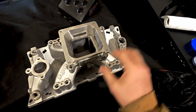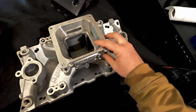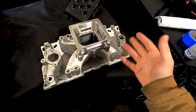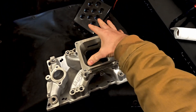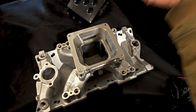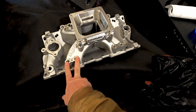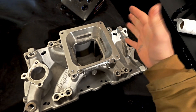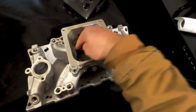Because the injectors are gonna be doing all the enrichment — we're not worrying about spraying fuel in here, it's just gonna be nitrous. But this funneling down could potentially cause a problem for distribution. Maybe, maybe not, not sure. We were talking to Induction Solutions and a couple other guys, and I don't think they're seeing what we're talking about here. They said just put a plate here, then put this on top, then put your throttle body up here. I don't like that because air is gonna come down — of course it's gonna be just air coming down, not worrying about fuel. Our injectors are gonna be supplying all distribution. But I just don't like anything in between this for air to hit and maybe cause turbulence and some weird stuff going on in the plenum, because there's already gonna be so much turbulence in here.